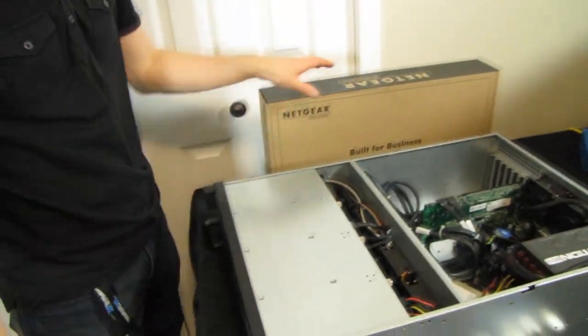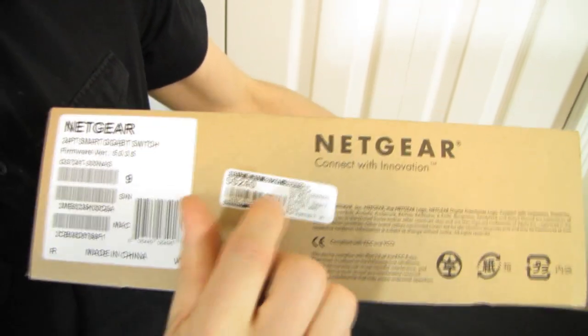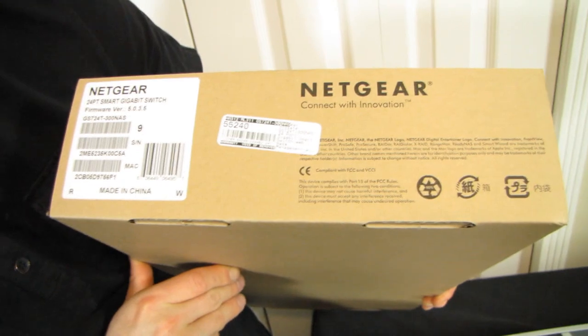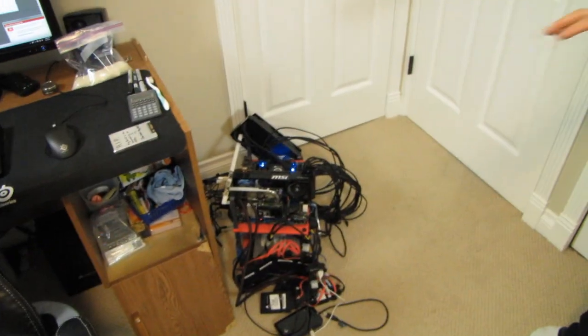The requirement for five-gigabit teaming is that you need a manageable switch. I'm going to use this 24-port gigabit smart switch — it's a couple hundred dollars with even a $25 mail-in rebate — the Netgear ProSafe GS724T. So between my computer and the Windows Home Server on the other side of the wall, I'll have a five-gigabit-per-second connection, and the rest of the house will just be gigabit. Combined with RAID 6, the additional performance from dropping the ghetto drive pool should give me screaming performance between those two PCs.